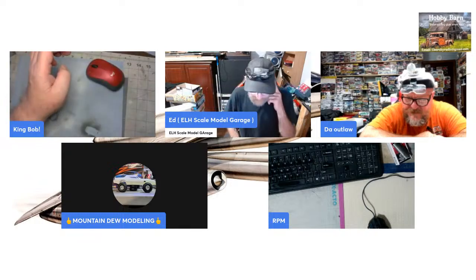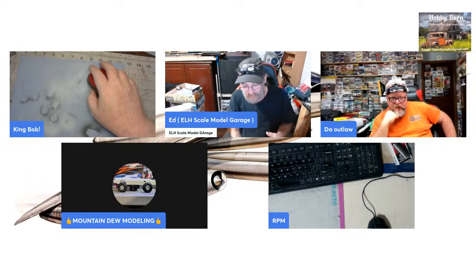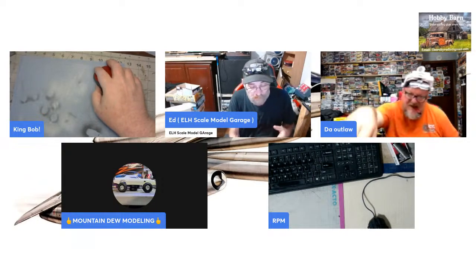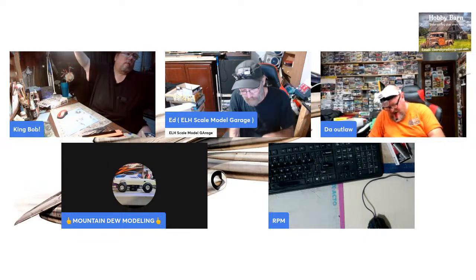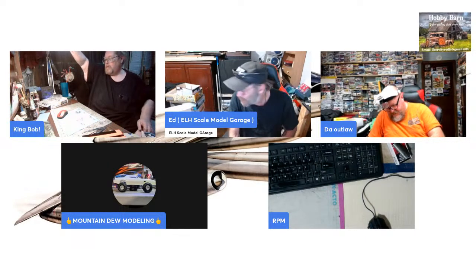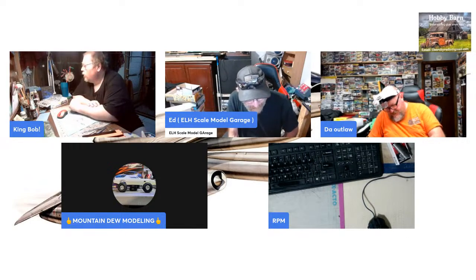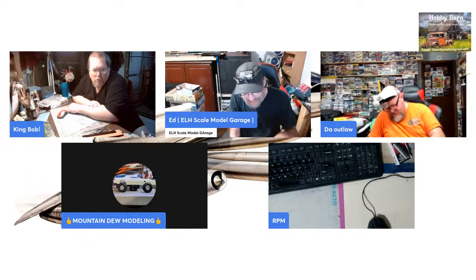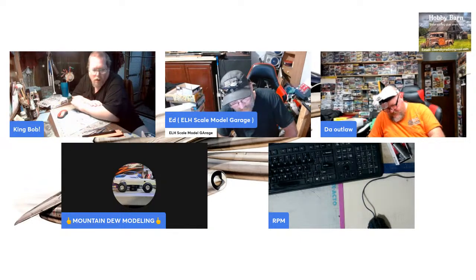And the springs and all that, because the diff for the Hemi version is a heavier duty diff and heavier duty rear axle. But the springs have the axle set further away from the chassis rail because those springs are meant for racing slicks. And I'm wanting this car set down on these tri-blades, pro touring style. So I'm going to have to modify these springs a bit to drop that axle back down toward the chassis.